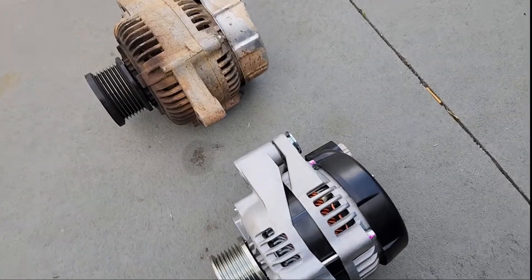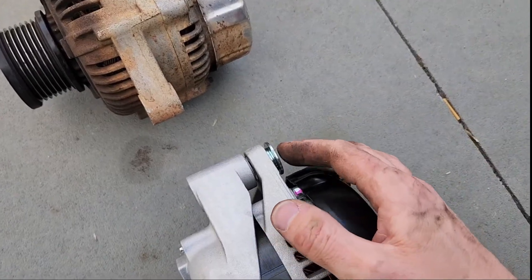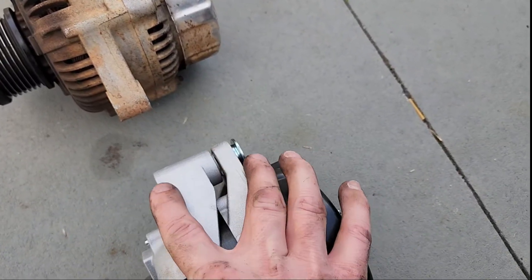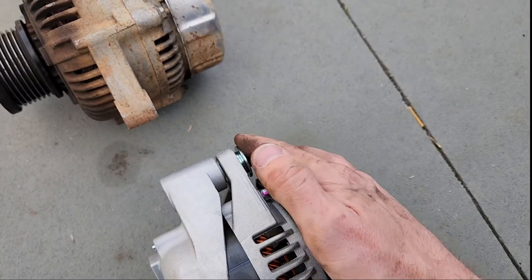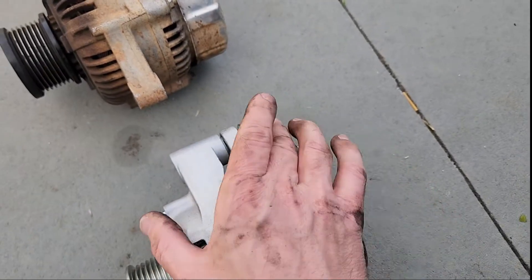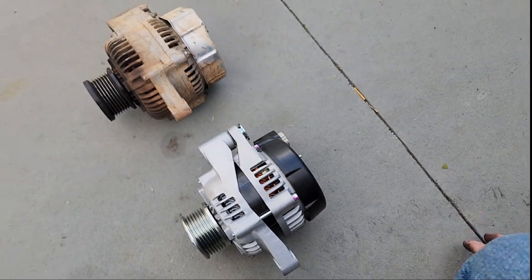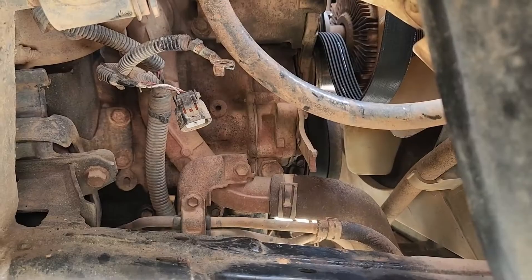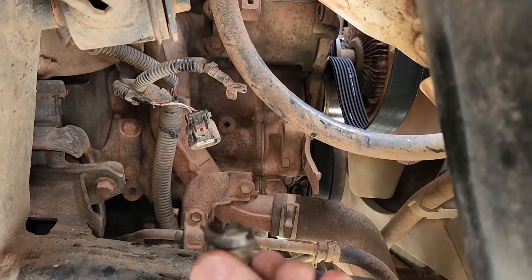Here's the new and old alternator together. We do have a bit of a sliding spacer in here that will slide up and take up the slack without being too loose in its mounting housing, so just leave that as it is. When we pull the bolt in, this will move if required to fill that gap. Comparably, they are the same — let's stick this one in.